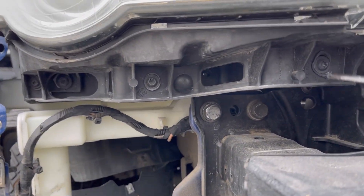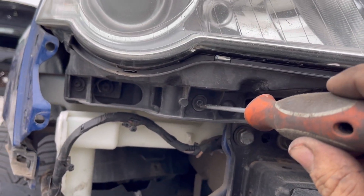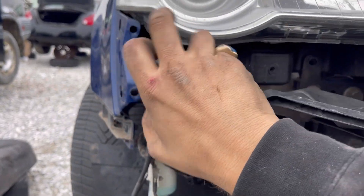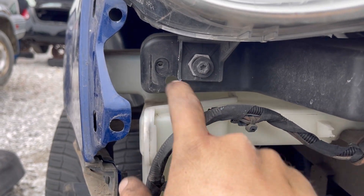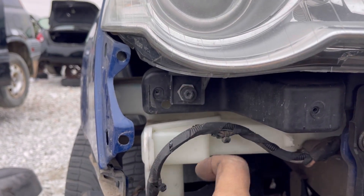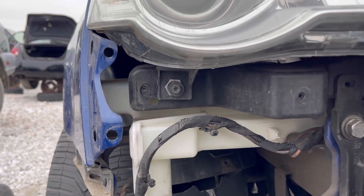Now we've got these bottom bolts, and it looks like this has been off before. Like I said, this thing's probably been in a wreck. So we're going to get these T25s out, and then that third one right there. By the time you get this third one out, you have lots of access to this last one. Keep in mind there probably are witness marks, but it might not be a bad idea to put a little bit of fast-drying spray paint on this — just be careful not to get it on the lens. Maybe use a paint pen, or tell me what you like to use. It's a good idea to screw it back exactly where you found it. That one's a little bit too tight for my T25, so I've got to grab the proper tool — T30 or 10mm.